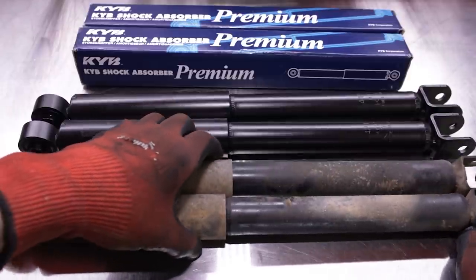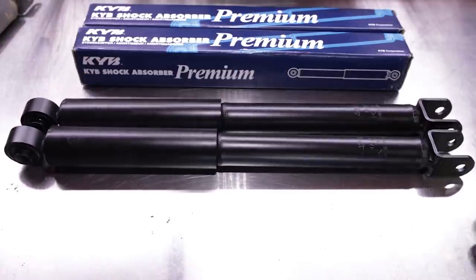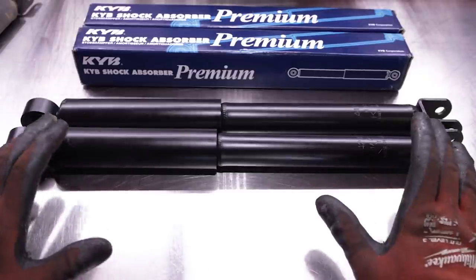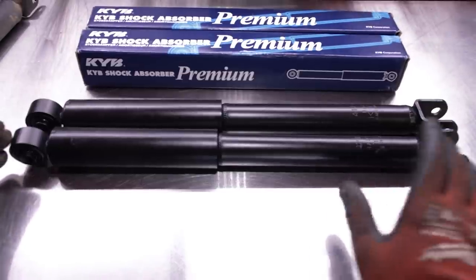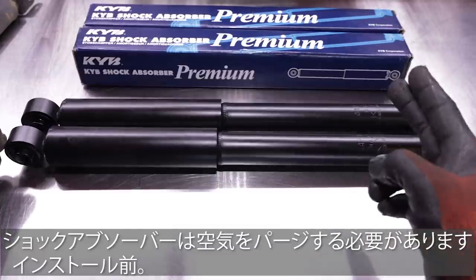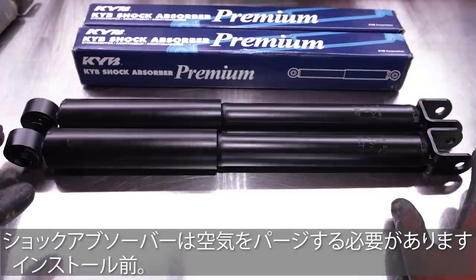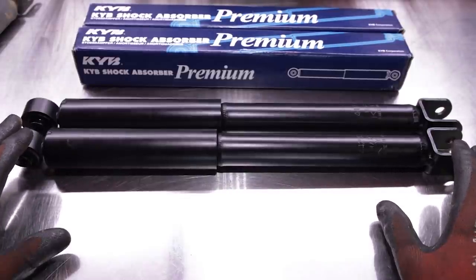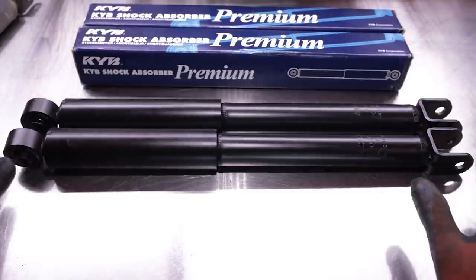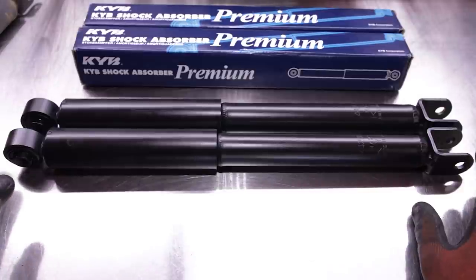This is a little bit of an odd detail — I found out yesterday that these are not like a traditional gas-charged strut shock that you would have on a regular vehicle. These come shipped completely collapsed. Normally there is a metal or plastic band wrapped around shocks to keep them compressed during shipping, and then you snip that band and they fire out to full extension. Not so with these — they are not under full pressure. These are a dampener for the coil spring more than an actual gas-powered strut shock. There is a procedure to bleed air from these because they can get trapped air in them during shipping while compressed.